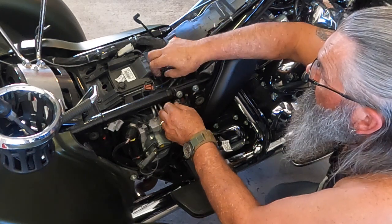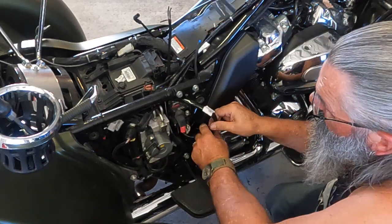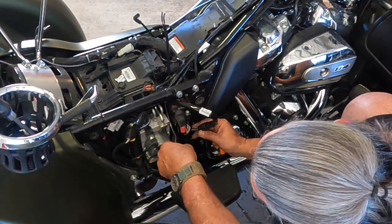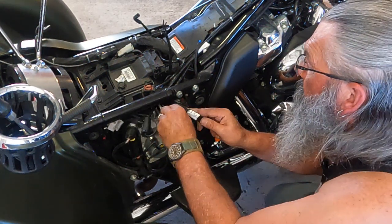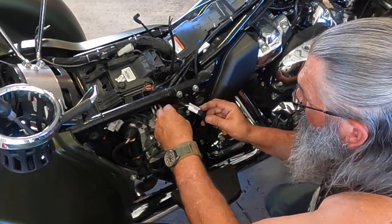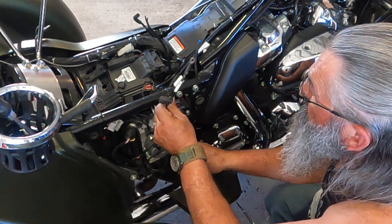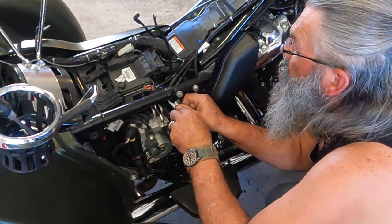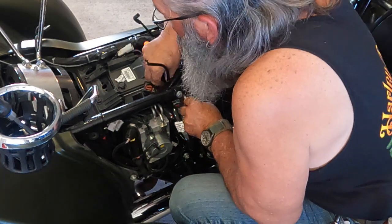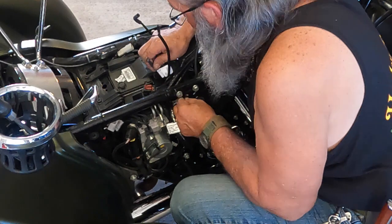Now with the accessory cable up here, I'm going to feed these other wires back in and tuck them out of the way — there's a pretty good little space in here. You want to get them out of the way in case you have another accessory you'd like to use at a later date. We're going to feed this one through so we can get it over to the battery terminal. I'll pull this cover off the battery so I can get this attached to the positive terminal.